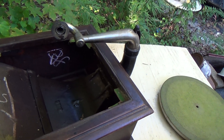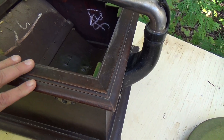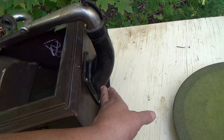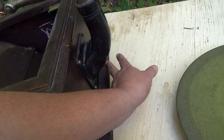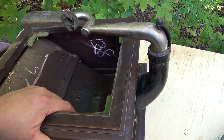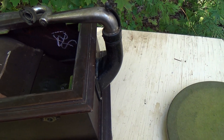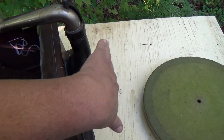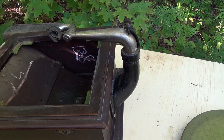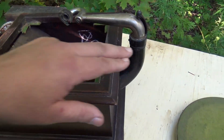We will get it playing again probably tomorrow — it's a little late in the day now for me to start any big projects. Another word about these: if you ever have to ship a Victrola IV or a Victrola VI — those are the two small tabletop models Victor had without lids — it's always a good idea to take the back bracket off. It's four flathead screws right there, come out real easy, and this whole piece comes right off with the tonearm. You wrap that separately and ship it in its own little box so it doesn't get banged around, or if the machine is dropped in transit this could be damaged — you could end up snapping this off. Plus, you don't have to have quite as big a box if you don't have to worry about this extra two and a half inches sticking out. The owner did not know to take that off, and I forgot to tell him — he actually shipped it before I could send him shipping instructions. But no harm was done this time. Should anybody watching this have to ship one of these machines, always take that off.